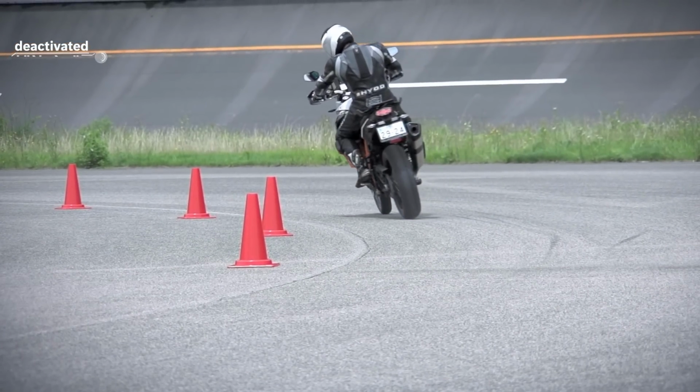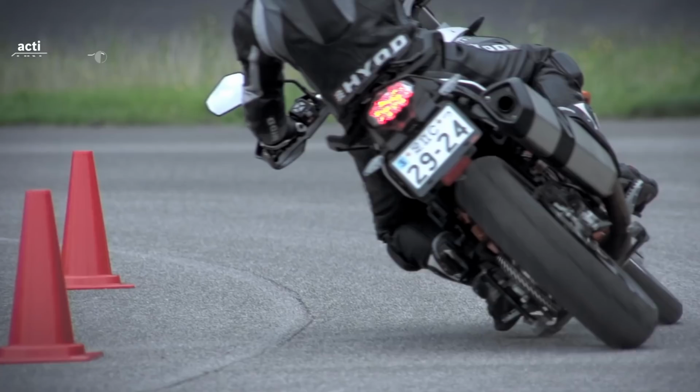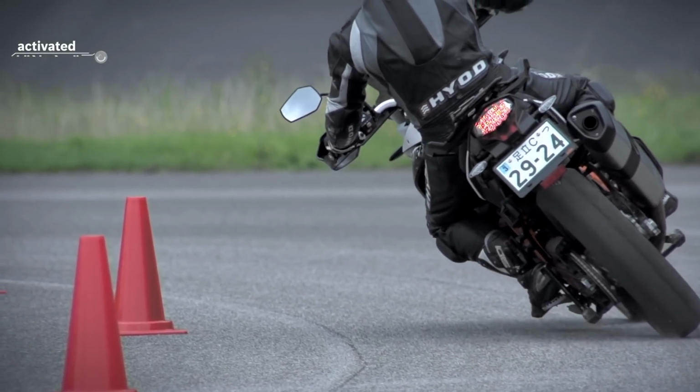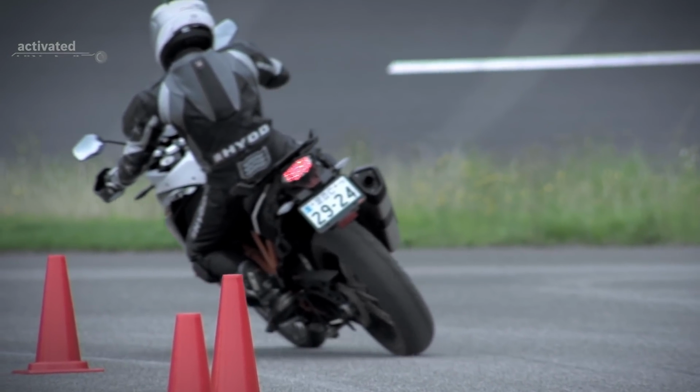Since the bike now knows what it's doing in 3D space, converting standard ABS to cornering ABS doesn't really cost the manufacturer anything since it's just software. There are no parts that need to be added on the bike, it's basically just code. But there is absolutely no mention of traction control on the new World Raid, and the ABS is definitely not lean sensitive. It's a little mystery we have here.